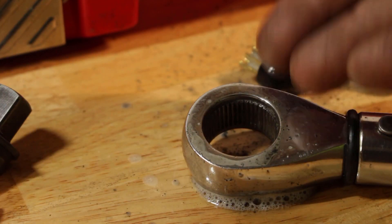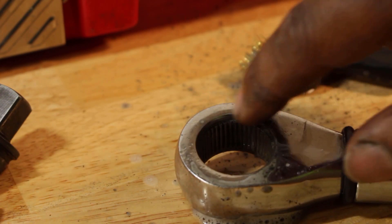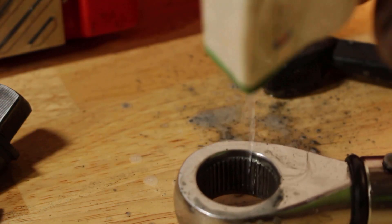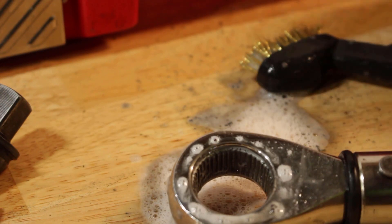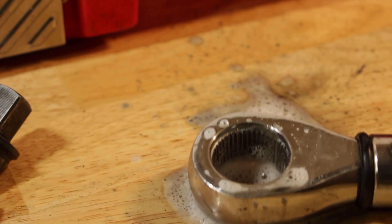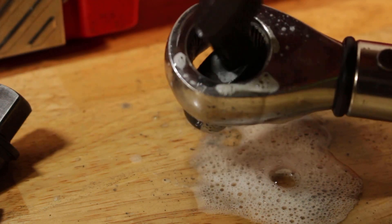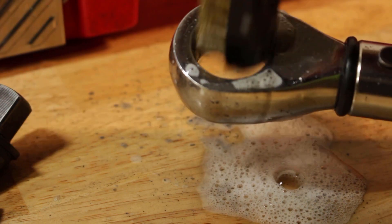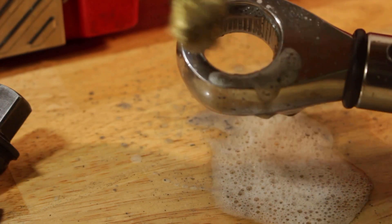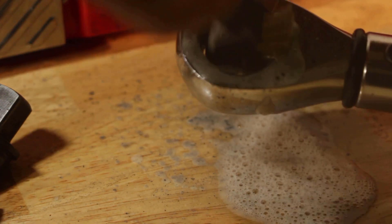So here I am a little closer so you guys can actually see what I'm doing. If you notice, there is a little bit of buildup inside the teeth here — a little bit of dirt. So all I'm going to do is take some Spray 9, spray it in there, and run this bristle brush through it just so that pawl has a better area to grab onto. Make sure all of these teeth are clean, and just like that the thing is clean.